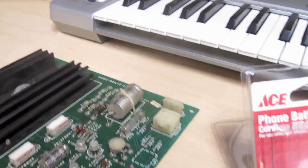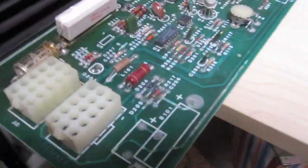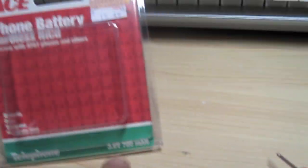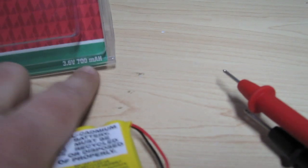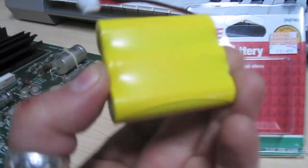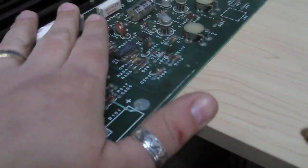The one downfall with using the original MCR power supply versus the switcher is that the original has had the battery removed, which is what you want because these batteries leak. But these batteries also save the high score, which I want. So what you can do is replace the battery with a cordless phone battery. I went to Ace Hardware and picked up one of these — you want a 3.6-volt cordless phone battery. I read online that you should get 300 to 600 milliamps per hour, however they had 700, which I think should be okay. These were 15 bucks. I'm going to cut this and solder the positive and negative on the appropriate points, then install it in the bottom of the cabinet away from the power supply so that if it leaks, it doesn't leak onto the power supply board.